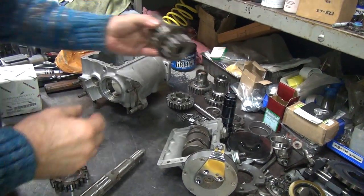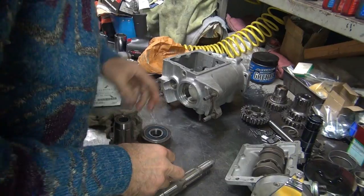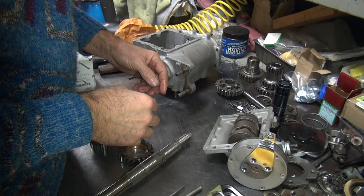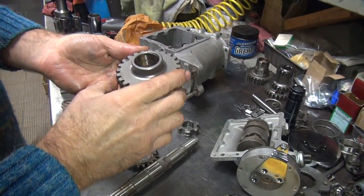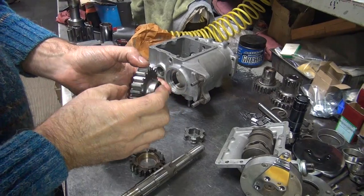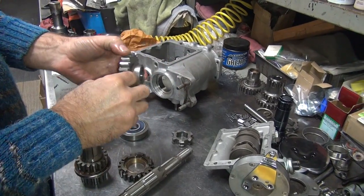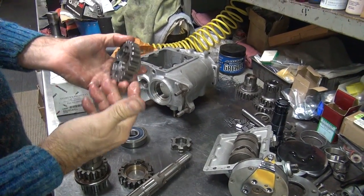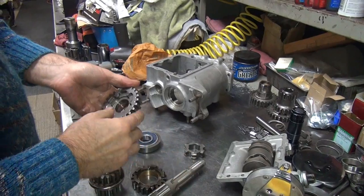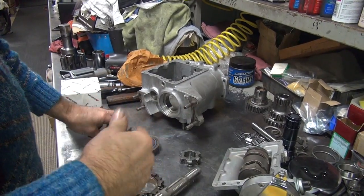There's two different third gear ratios, which is a cluster. It's third because this is third gear, and that one we saw was marked on it as 1-2-3. I think that's the stock Harley ratio. Where's the third gear? Yeah, 1-2-3, I'm pretty sure stock FL ratio. What that does is it puts third gear right next to fourth, so it's like having a five-speed tranny when you're going from fourth to fifth. It's real close together, but the second to third is real far apart, because when they put it close to high, they take it away from second. So the 2-3 upshift's a big upshift. It works good if you need to go down just one gear to go up a hill or something.